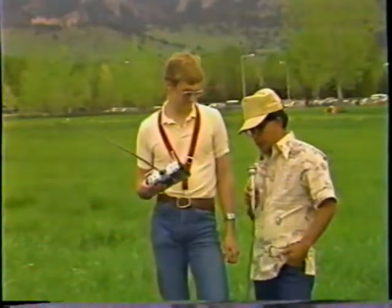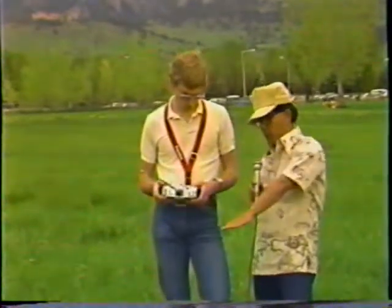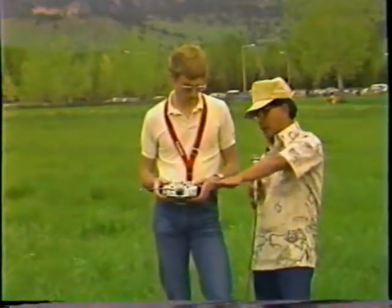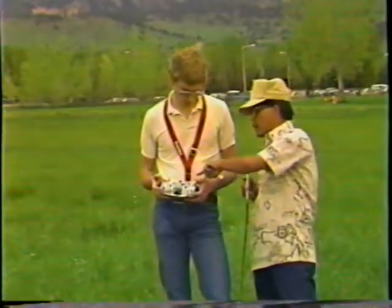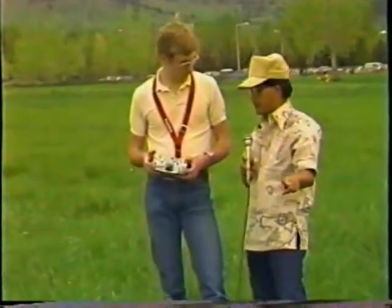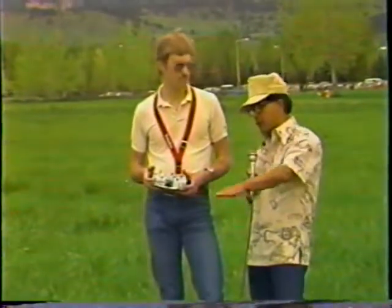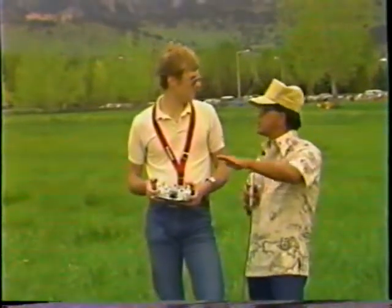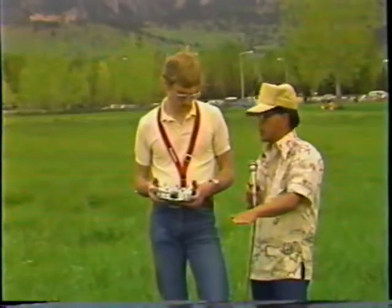So to do that, what we're going to do is several exercises. It's going to be building up in steps. We're going to start at about 2 feet, get in a hover, hit the throttle hold, disengaging the collective, whereby I want you to give max pitch and to your left, because you still have tail rotor control in this initial phase. We'll do that several times. The attempt here is for you to get the feel of the aircraft actually landing and how soft it is on the ground. Mm-hmm.